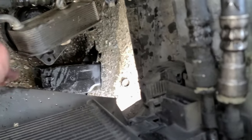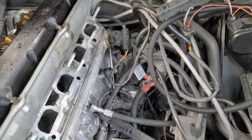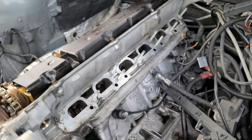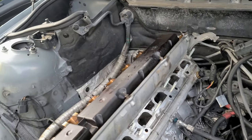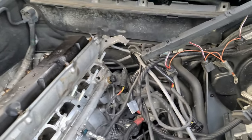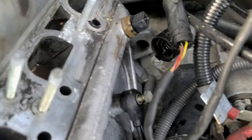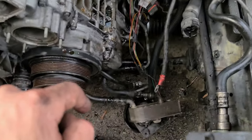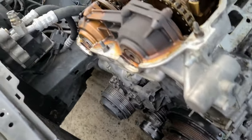Transmission, coolant. I don't know if I'm gonna go with manual for this, or just keep it automatic. But that transmission is tired. It works, but despite my oil changes and services, sometimes it gets stuck between third and fourth, so the car keeps revving to almost 7k and the transmission does not shift. Happens occasionally, but if you add extra power here, it just won't hold. If you agree on this, let me know. I think everyone agrees on that. So if I do manual, I don't know if the radiator probably will be brand new too.